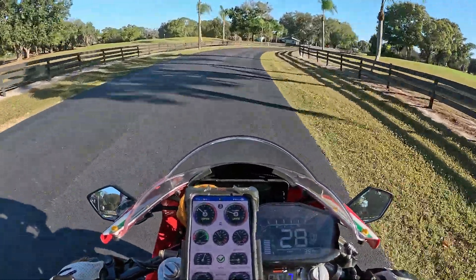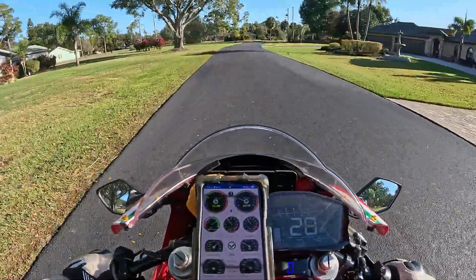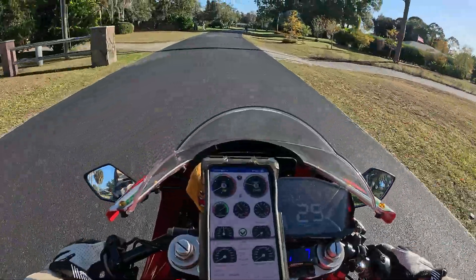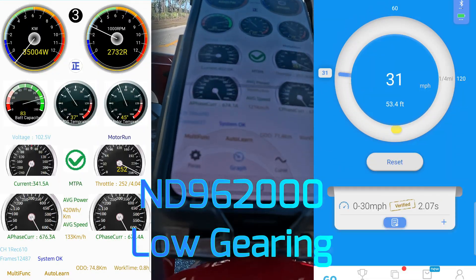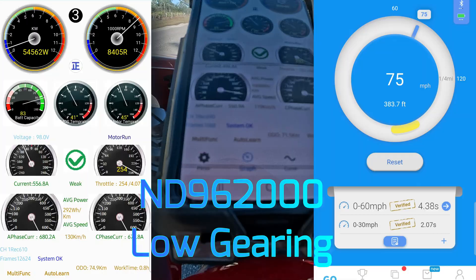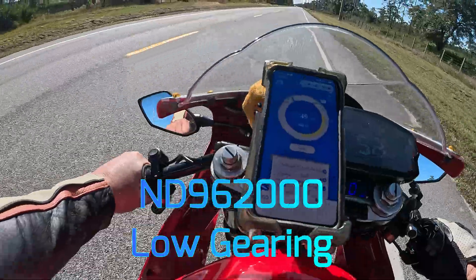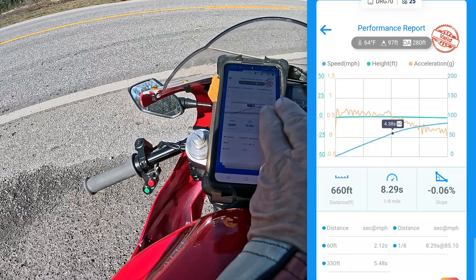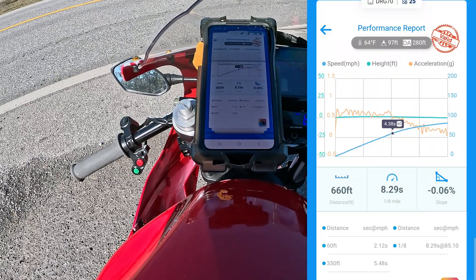It's pretty much the same. This is a 400 pound bike, so you're going to get very different results if you're running a smaller bike like the Mad Dog scooter I had, or a moped, anything like a Honda Grom — you're going to get a whole lot better results. I'm on a heavy bike, so I'm going to get poor results. Right now I would say the 1800 is not worth the upgrade, but we'll get this bike geared back to where it belongs and see if it is. I remembered to recalibrate my speedo this time. I've got the big sprocket on so it's geared lower. Basically it's about the same. For this particular setup, this GTS 35, I went from a 4.59 to a 4.38 in zero to 60 — a couple of tenths. And in the eighth mile I think it went from 8.55 to 8.29, so about a couple of tenths there too. It does go faster, but it's not worth it.